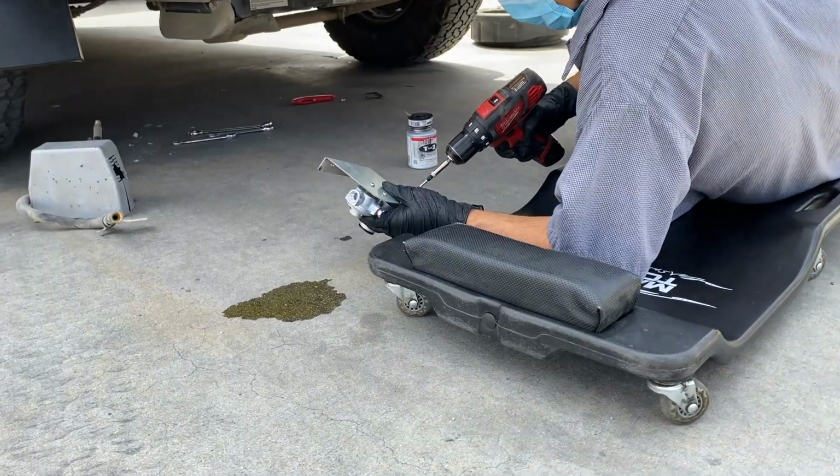On the summer trip, we had a lot of issues with our propane. It would work and then it wouldn't work. And we thought we had it solved in Colorado when the technician came out and did a few things to it. While we were on the road, we ordered a new regulator because this has been in the back of my mind for a long time. A lot of you have said it's probably the regulator, and you were absolutely right. And so we took it into our dealer who replaced the regulator.